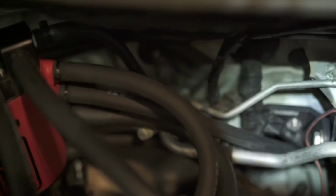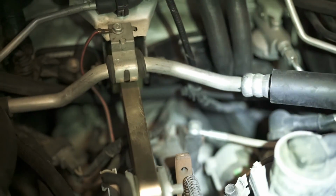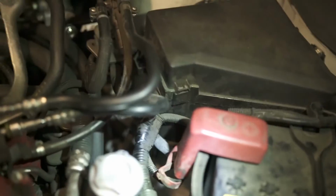Top one, down around underneath the bracket, underneath the wiring harness towards the passenger breather port, the forwardmost breather port there. Can you even see it? Yes, you can. The one on the right, basically. Middle line, underneath the pitch stop, around towards the right breather port, which is over here.